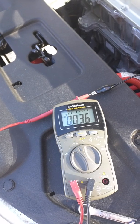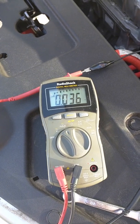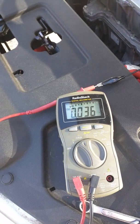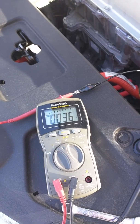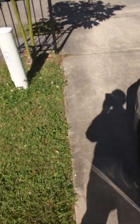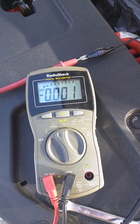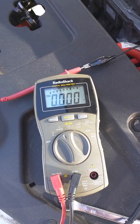That tells us the solar panel is actually providing approximately 40 milliamps under full sun to the car and the battery. Let's confirm — take the blanket off and go back and look at the current. As you can see, it's dropped to essentially zero. The car is not drawing any power from the battery at all.